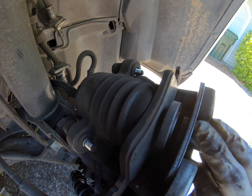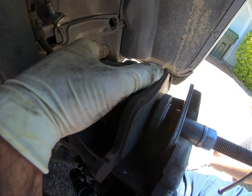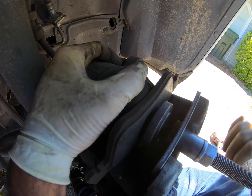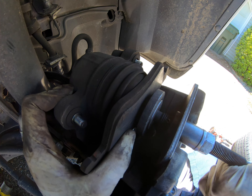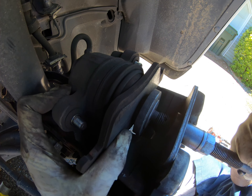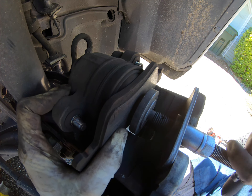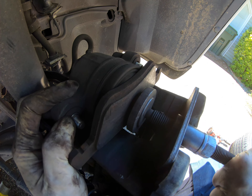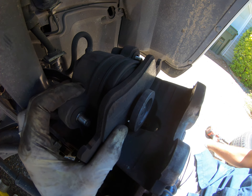We're gonna go ahead and compress the caliper piston. Whatever I show you on this side is pretty much the same thing you're gonna do on the other side. Now if you do this without opening any brake lines, it is going to push the fluid back a little bit on the reservoir, so be aware of that — or else you will have what looks like a leak, brake fluid coming down from the engine, and you'll be wondering where it's coming from. That'll be exactly where it's coming from: the brake reservoir. Surprisingly, it's happened to me still, but I typically catch it beforehand.